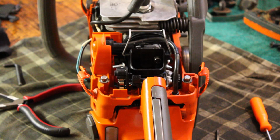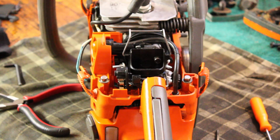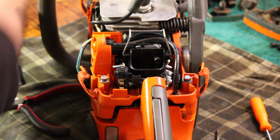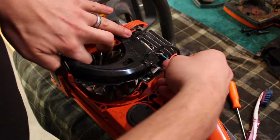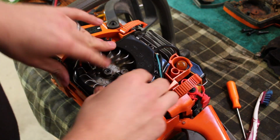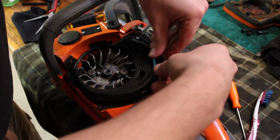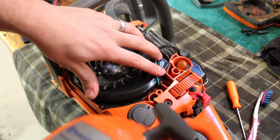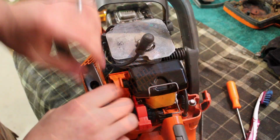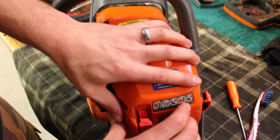I'm going to blow out this air cleaner. Doesn't look too bad actually, but I'll give it a little spray. Yeah, the air cleaner is actually the cleanest part of the saw. Before I put that back on there, let's put the choke slash kill switch back on. If I remember correctly, this goes somewhere in this general area, kind of like that. And those snap down into there, nice and tidy. And then we can put our recoil back. That's on there nice and good. She looks pretty dang good